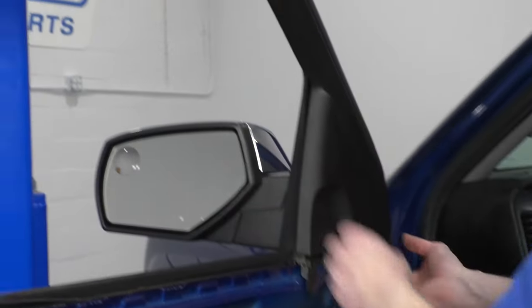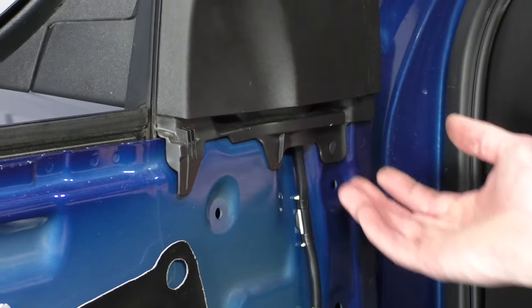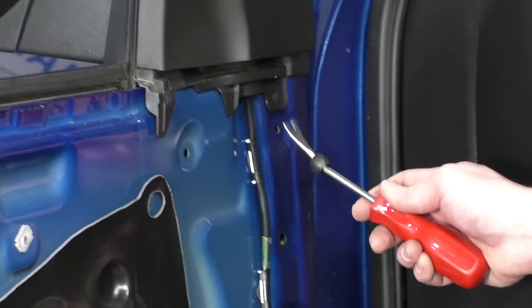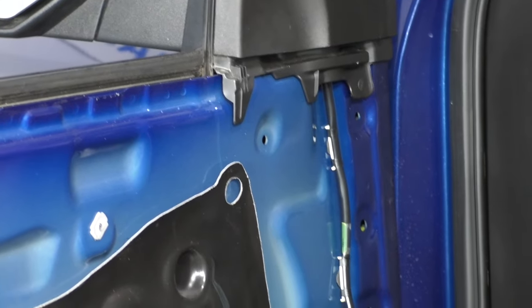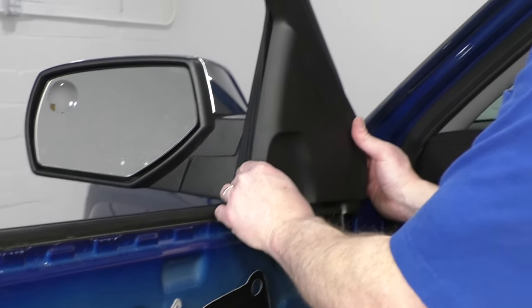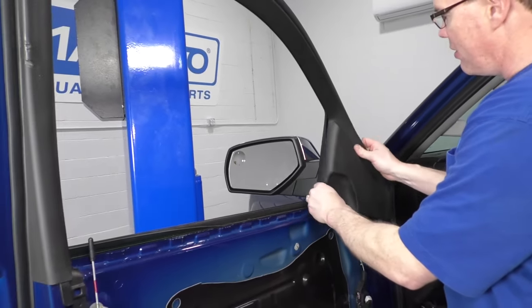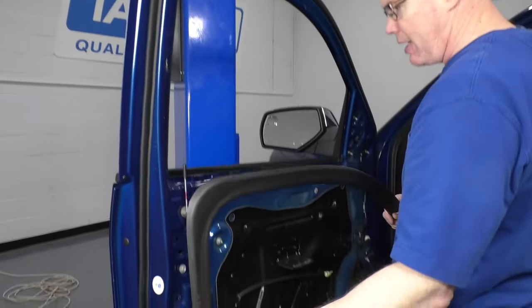With the door panel off, we can now remove the inside trim panel. There's a little clip here that you can usually pull on, and there's also going to be a clip there — it's missing on this truck. The correct tool from 1AAuto.com is this little kind of forceps — pry that out. If you didn't have one you could use a flat blade screwdriver. Remove those two pins, then there's a clip behind here that you have to pull firmly and release, basically pulling this out and down all the way around. Pull that pin out there and it comes off.